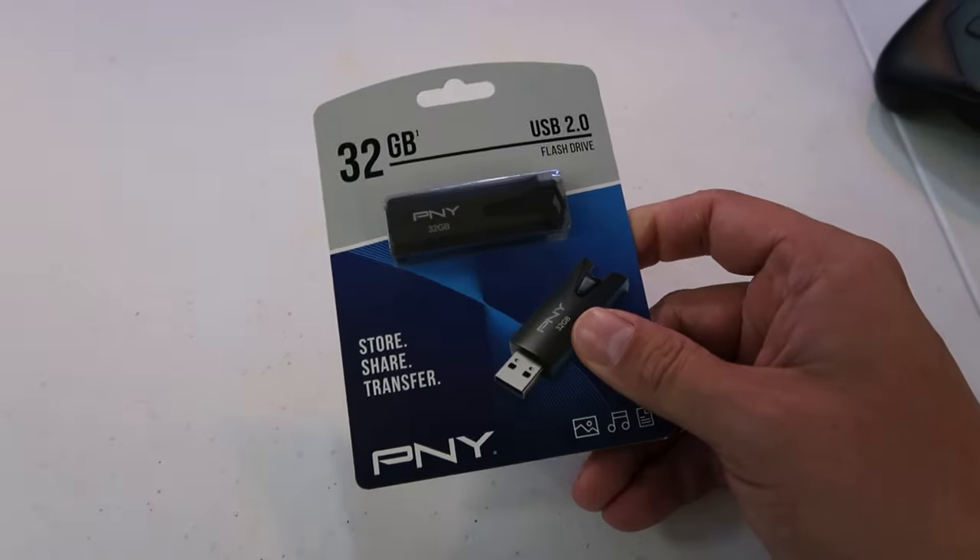This is where things get a little tricky. The USB flash drive I used in this video was a very old one — speeds like 2.0 megabytes per second, really slow. It took one hour and never booted. I tried an SD card because I saw others talking about it online, but I really think it's the write speeds. I bought a brand new USB flash drive and it worked in less than 15 minutes. If you use a USB-C flash drive it's only going to take a couple minutes and it'll boot right up.